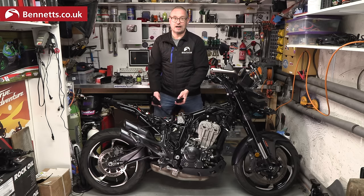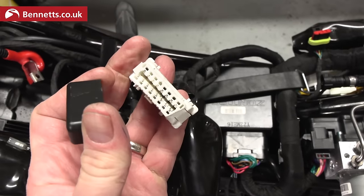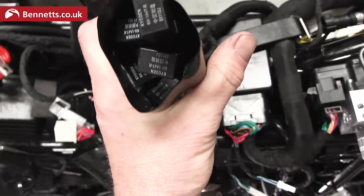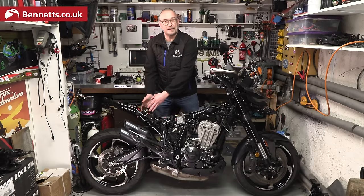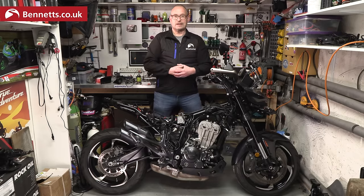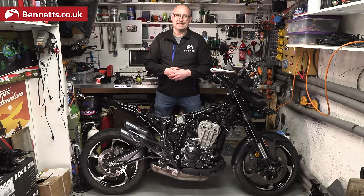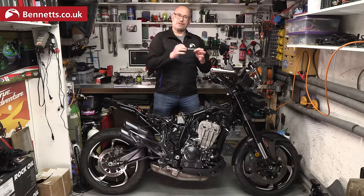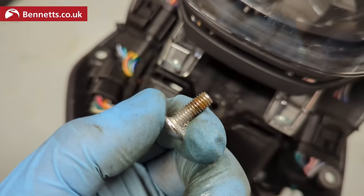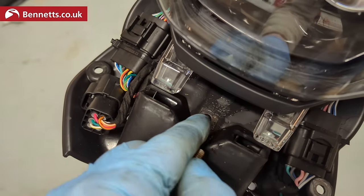On the sides, these connections are all under the seat and in the side panels. I actually found the diagnostics port, and there are loads of connectors and relays under here. I did notice some moisture in one of these, but only within the rubber shield, and I think that was from when I was washing it — so just bear that in mind if you spray and wash in there. The only place I found water trapped was on the front, and it was foamy water from the cleaning the night before.